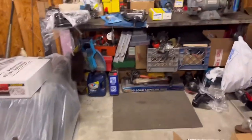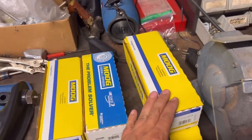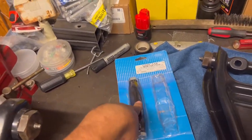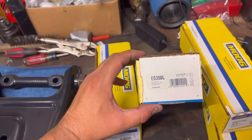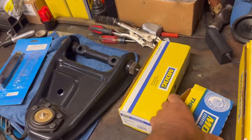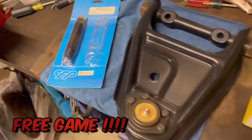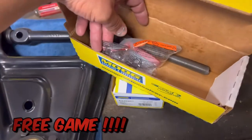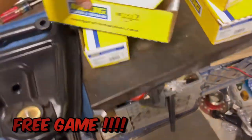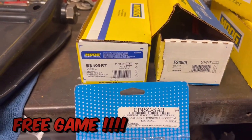The bump in the road I found: you're gonna have to use not the inner but the outer tie rod end. I ended up thinking it was the inner tie rod — so I got these inner tie rod ends — but they will not thread into here because it's reverse thread. So you're gonna have to get the outer tie rod end, which makes no sense, but I was looking everywhere online and couldn't find anything. I ended up calling CPP and the guy blessed me with that knowledge — so this is the part you need. These two together are what you need for your front disc brake conversion.